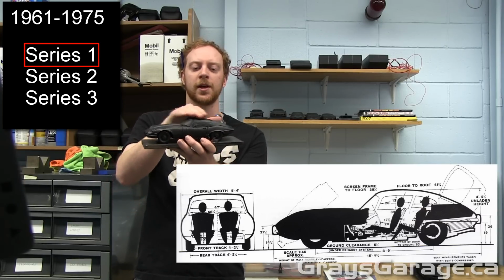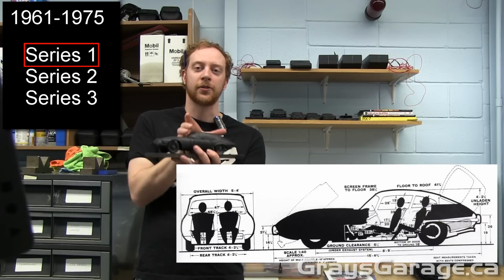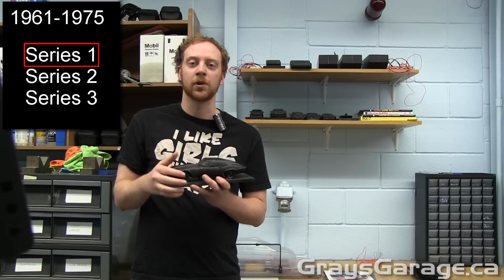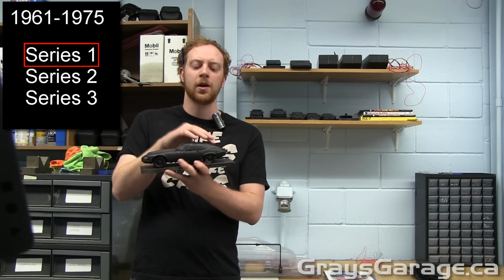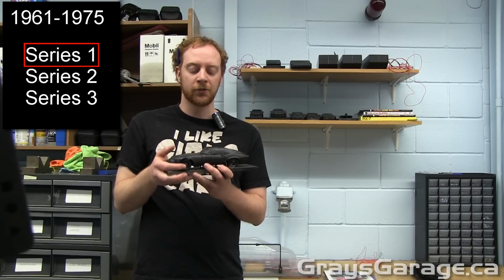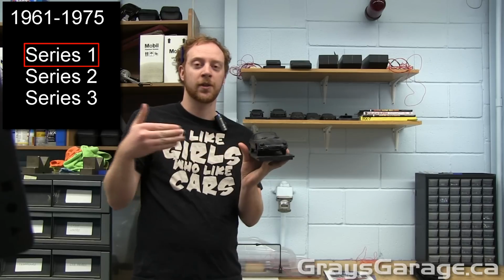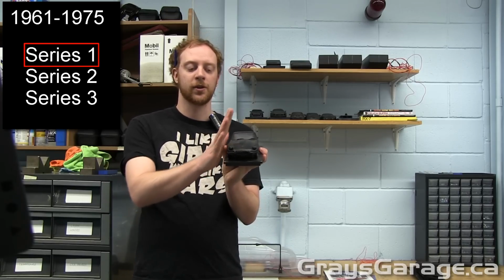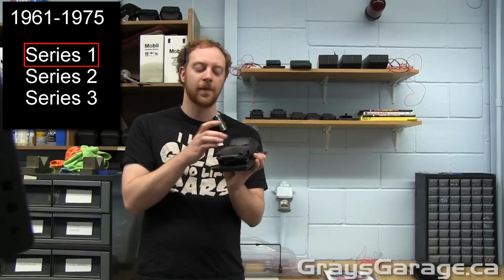So the back of the vehicle had a different slope because there are now 4 people sitting inside of it, and it's stretched 9 inches. We're going to talk about that a little bit more later and think about the different types of aerodynamics that are happening when you have the 2+2 versus just the 2-seater. It was also noted that the 2+2 had more effect with side winds, so when the wind is hitting the car from the side, and that's mostly due to the larger surface area on the 2+2, because the car is being stretched.